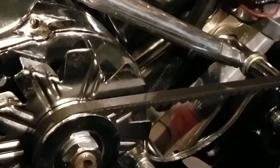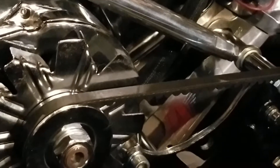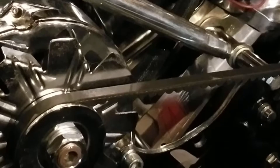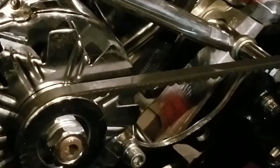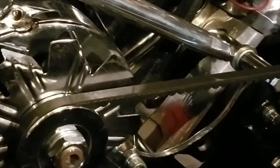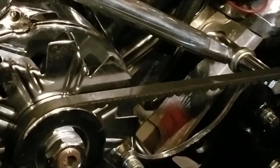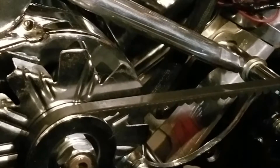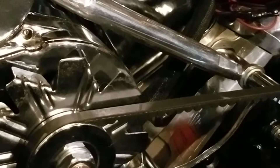Welcome back. I'm going to call this one my trick-or-treat segment. For you guys that have an old-school small block Chevy, you'll know what I'm talking about — the difference between a long and short water pump. Really, the difference to me is what side the alternator winds up on. Usually with a short water pump, the alternator winds up on the driver's side; with a long water pump, it usually winds up on the passenger side.